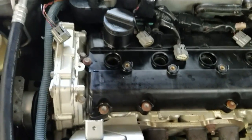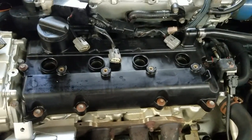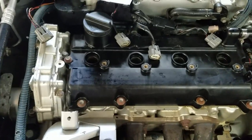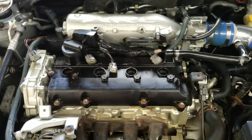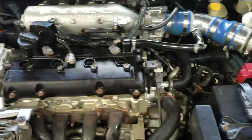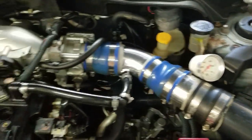I checked everything else and I've got pretty decent compression on all cylinders except number two, which is at 179 — everything else is 185, and that's great for this engine because they recommend 150. The leak-down test is great too. I've always needed a smoke machine to see if I can smoke the intake and find any vacuum leaks since it's showing a lean code.